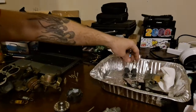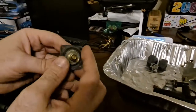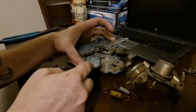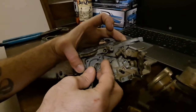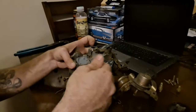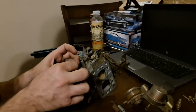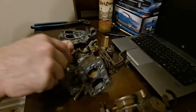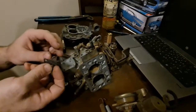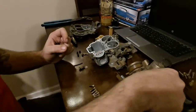You're going to be replacing your float with a brand new one — they're cheap, don't cheap out there. Your accelerator pump — this is the spring I was talking about; it fits on the inside of the accelerator pump. The small side has a round bit in there that it locates on to keep it centered. You'll install the spring between the diaphragm, then shove the diaphragm down, put the cover on, and run the screws in — that's all there is to it. If you're servicing it on the car it's the same deal. Just don't lose the spring because if this is on the engine it's going to fall out, hit the ground, and you'll never find it — and you don't get that spring in the kit.